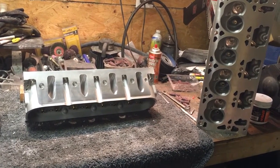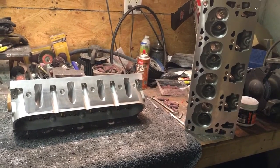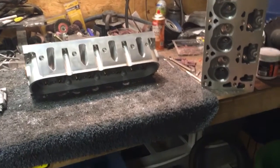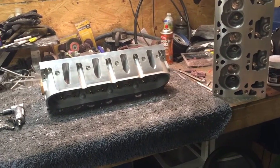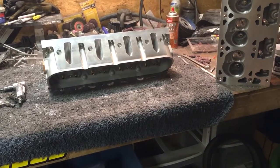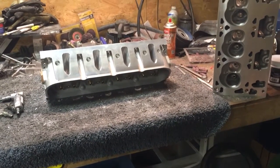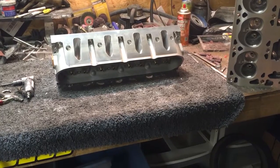If you have a legitimately decent-sized runner and you pay attention to detail on your bowl cut, bowl blend, short turn radius, widening, and maybe just reducing the profile of your valve guide a little bit — that's where you're going to make your power and get your results. So anyway, All Pro 215-plus cc LS cylinder heads, update 3.0. In case the customer was watching, I wanted him to know the meat and potatoes part of the porting is done. I just have to commit to the time-consuming portion of doing the surface texture on the rest of the port. I appreciate you guys watching and have more update videos scheduled — hopefully we'll get to them soon. You guys have a good one.